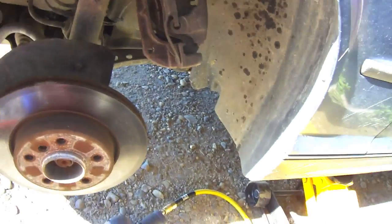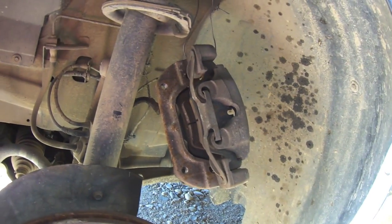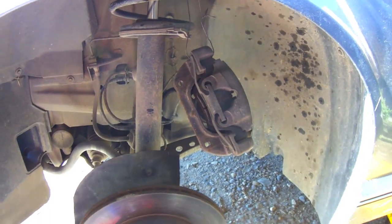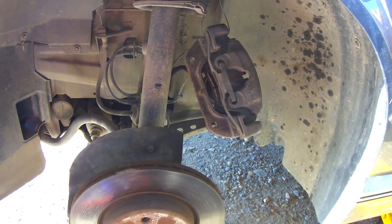This is a very important step and I can't stress this enough: when you take your brake caliper off, always suspend it by something — wire, rope, whatever you got. Don't let it hang on the ground because you're just gonna stress out that hose and crack it.